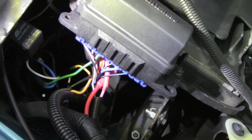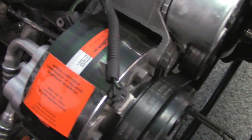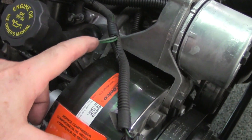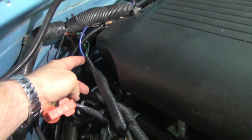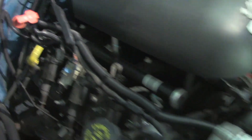For my signal to come off of the AC compressor, I ran a blue wire. I tucked it into the loom and ran it all behind in a wiring loom over to the compressor. On the compressor you've got the power switch at the clutch and the pressure switch — they both have a green wire, and those green wires come together back here to form one wire. I found that combined green wire and spliced my blue wire into it, so that is power from the compressor.